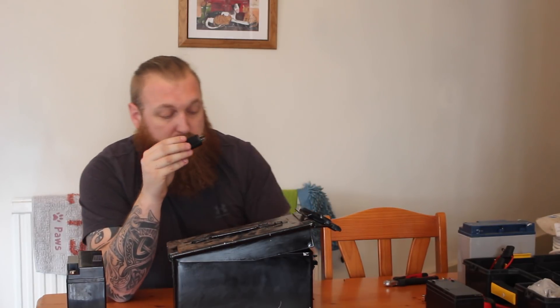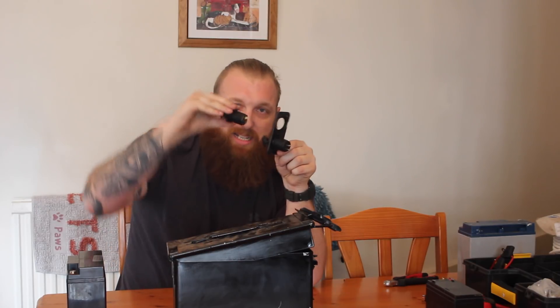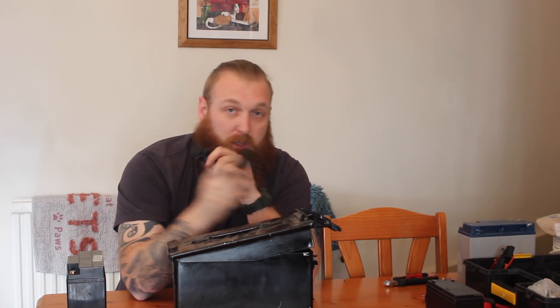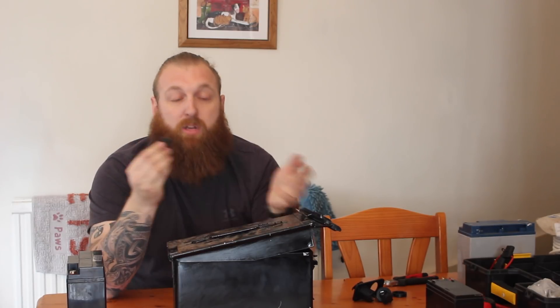What I've found is, if you don't get your measurements exactly perfect, they don't really want to sit in - there's a bit of a funny angle. So we're going to bob a hole in here, and we're going to do that twice because we've got two different chargers. The other thing we're going to have is an isolator switch - there's a million and one switches, just make sure it's high enough amperage for what you're actually going to be using it for, so you don't burn the thing out.